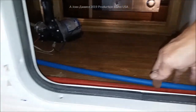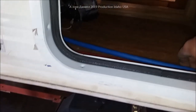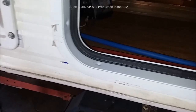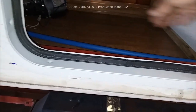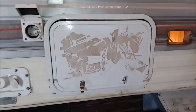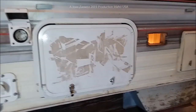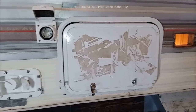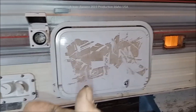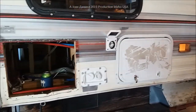We're going to get this framed in. I'm going to have a panel put over the top of the water lines right here, and lay some half-inch foam insulation down on top. Then put some 2x3 framing in to get to the height of the rim and put a piece of plywood down. We now have a battery compartment that'll handle four 35 amp-hour batteries. In the back we'll have another three 35 amp-hour batteries for a total of about 250 to 275 amp-hours. I have another space on the other side where I can put two more. The next stage is to run four-gauge wiring to all of these, run it to one spot, and put in my 2000-watt true sine wave inverter - and this thing will be ready to fly.